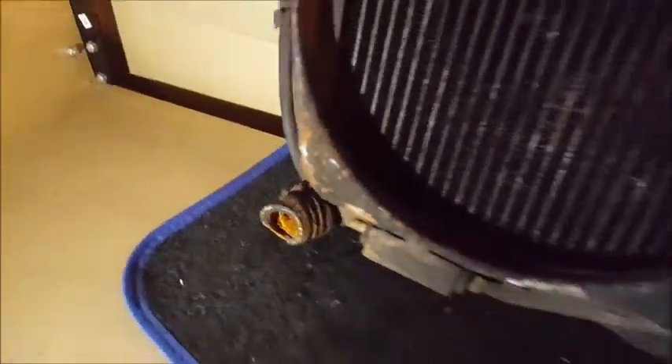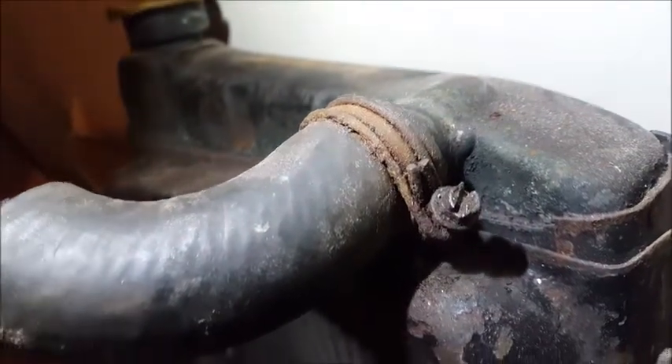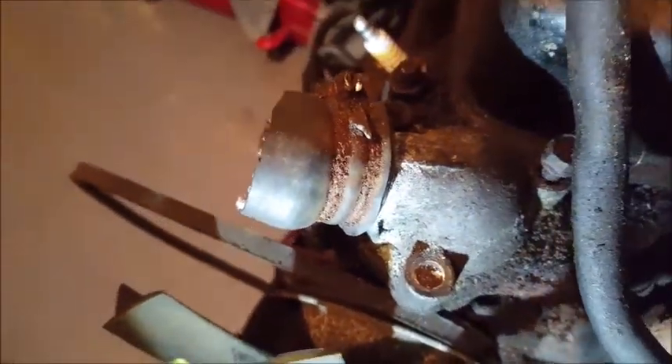The bottom hoses were already removed prior to this. What I did first was attempt to remove this top hose — like I say, it was not going anywhere; it was just going to snap off. So I decided just to cut the hose there. The end of the top hose goes on the radiator on that side, and then on the thermostat on this side. As you can see, the clip here was just as rusty, so that was the first step to get rid of the top hose.